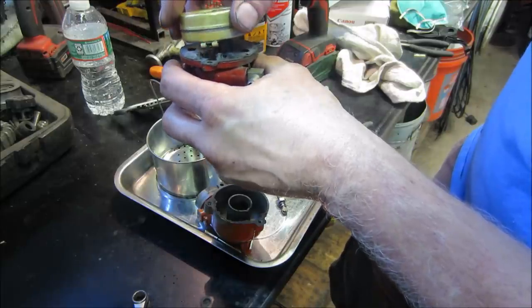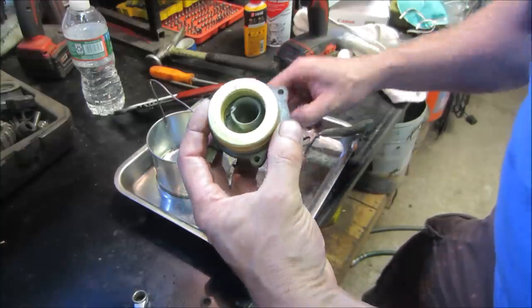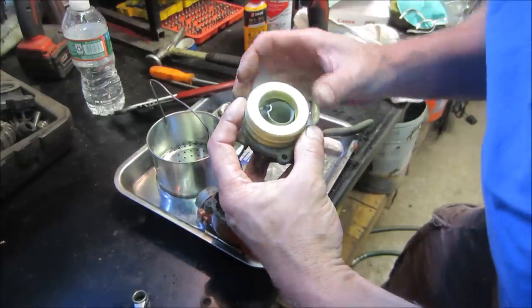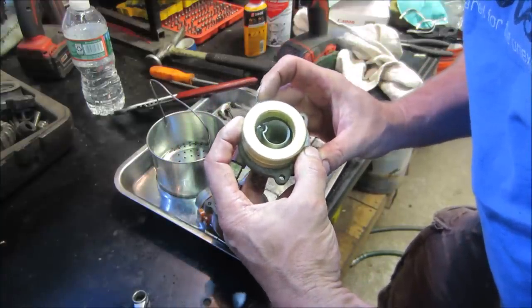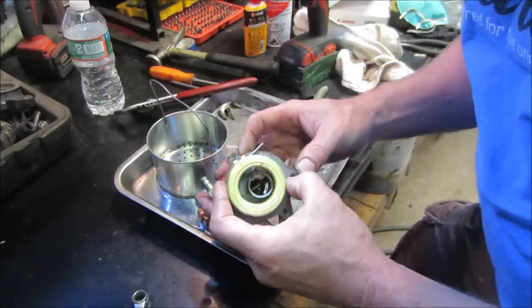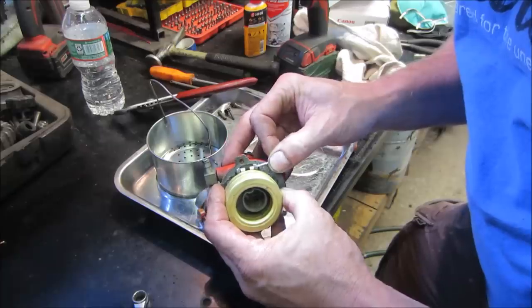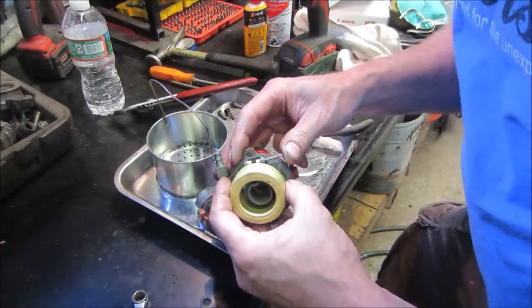Especially something that changes angles a lot. You want a little more fuel in because it could starve. And on the other side of it, if you go too much, it'll flood over, especially, you know, this having a kind of compromised gasket could be an issue. Trying to keep it in front of the camera.